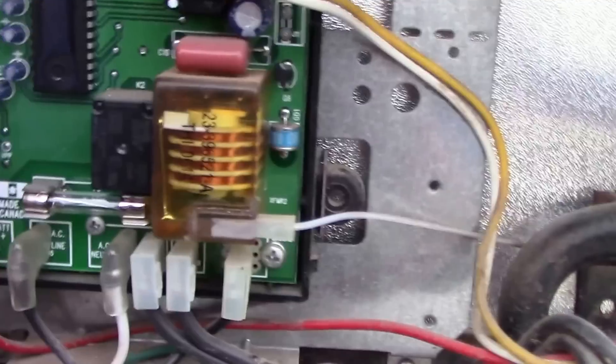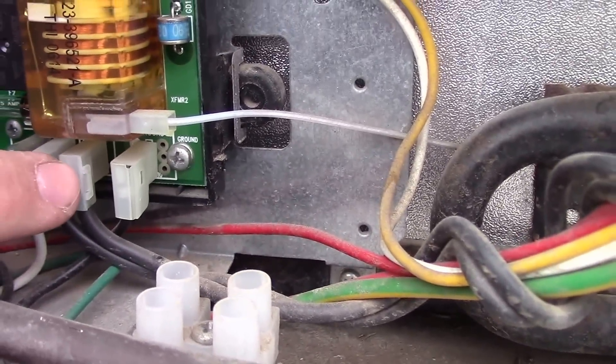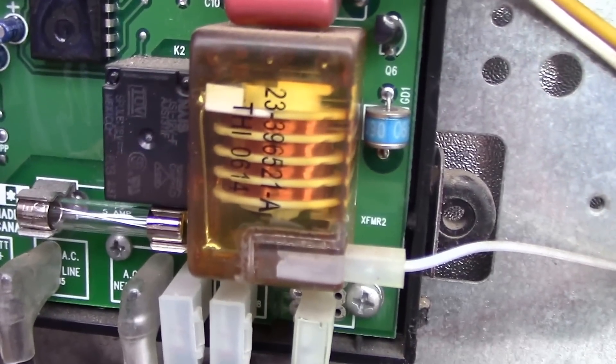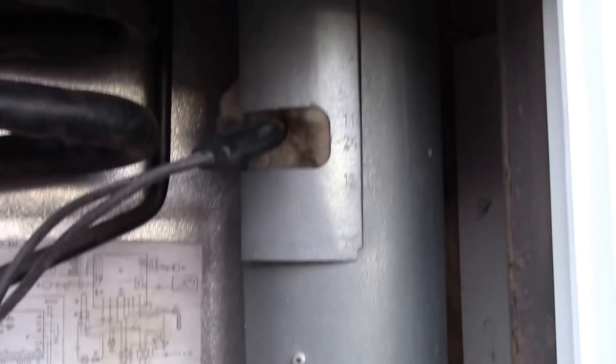I've replaced the fuse and had it on for an hour but it's still not getting cold. I'll leave it on overnight making sure the trailer is level. It hasn't blown again, so everything is okay circuit-wise, but I'm thinking the fridge element might be burnt out — it's right here. That's your fridge element for electric, running down into these two wires. Definitely check your fuse first. In my case it was blown. The fridge is no longer clicking on 110 volt — it's staying on auto — but the fridge isn't getting cold yet, so we'll see what happens.